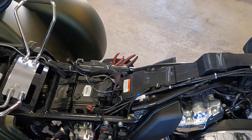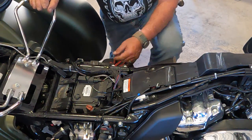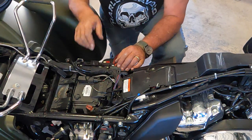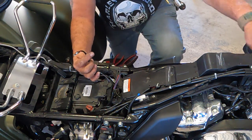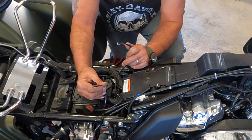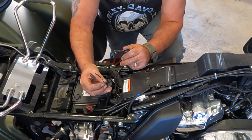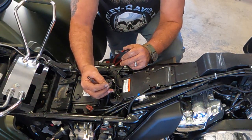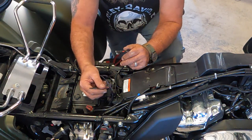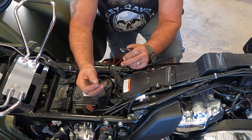I went ahead and pulled the battery cover off and got the power cord for the harness connected. Be sure whenever you're messing around down here with electrical connections underneath your left side cover, pull your main fuse — that way it kills power to everything as a safety measure. I routed the power cord for the heated grips through the tunnel and got everything put back in place. We've got red and black from the heated grips and red, black, and purple coming from the accessory kit. The purple should be keyed, but the instructions say to go directly to red and black.